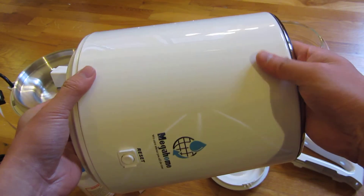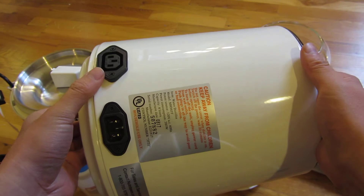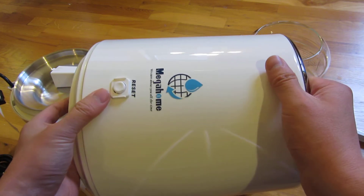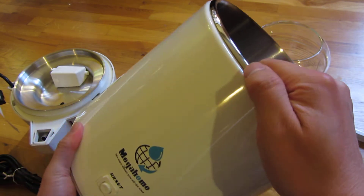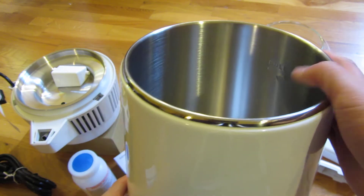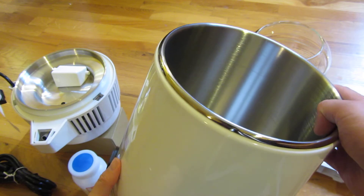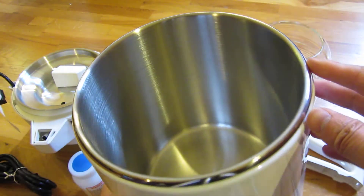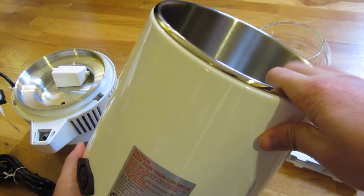Let me go around 360 so you can take a look. It does have two plugs, one for the cap. There is no on-off button — all this does is boil water and then auto shut off. The reset acts like a circuit breaker; if it triggers, you just hit reset. The cap or lid goes on via a gasket — there is no clamp or clasp. There's no leakage of water into the electrical mechanism or heating element, which is very important.